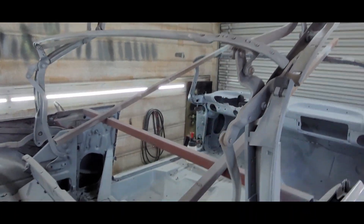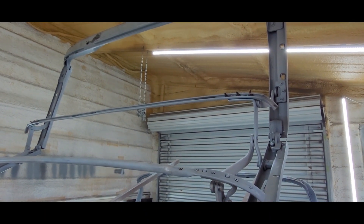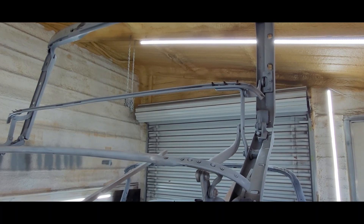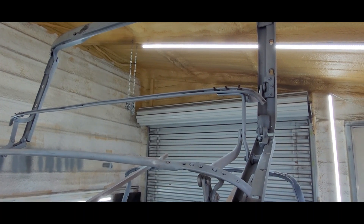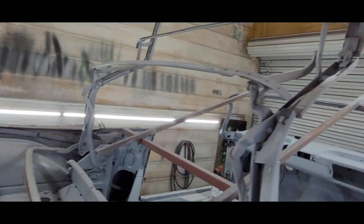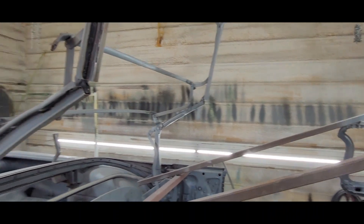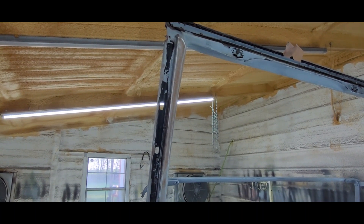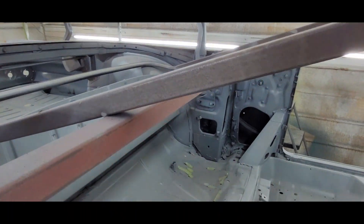This top rack had been sandblasted whenever I had the floors and the dash sandblasted. The guy who sandblasted it wasn't really focusing on the top rack — he kind of blew by it, so there were some areas he didn't hit. After sandblasting I got it in epoxy, and then today I sanded it by hand with 180 and some 80 grit on the DA. The interface across the header bow is extremely solid, which is good. The top rack is in really good shape. I opted to not take it off the car because it's never been off — it's exactly where GM put it.